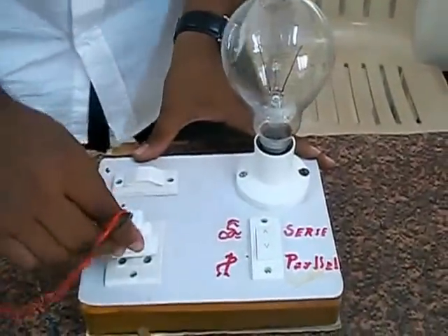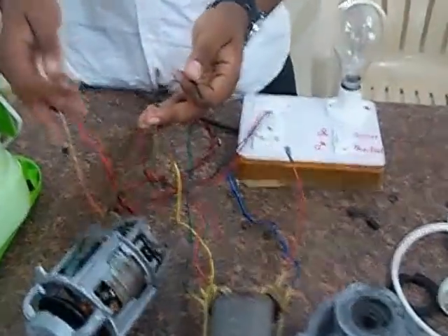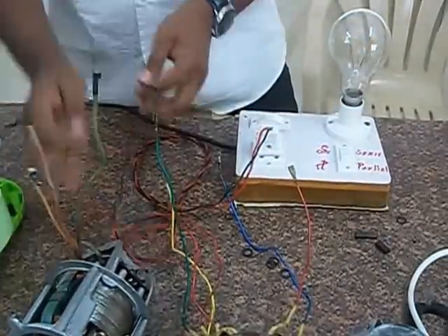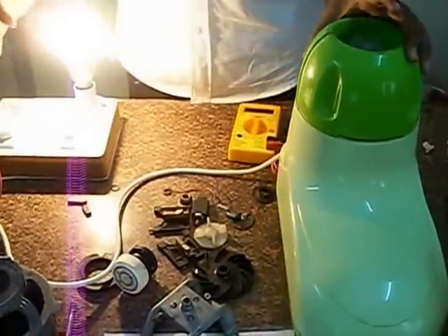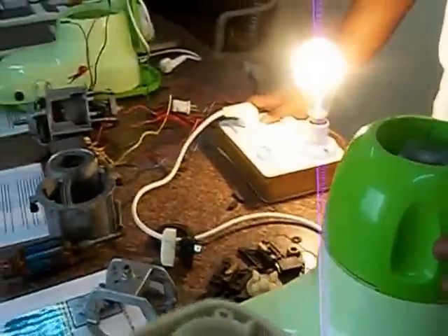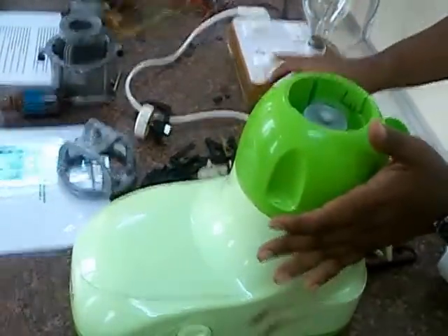With this series-parallel tester, you can check the winding. If the wires are short, it glows bright because there is a short circuit. This motor is a faulty one — the mixer winding is shorted. If the mixer is in perfectly working condition, the series-parallel tester will show a dim glow and the rotation is also slow, because the voltage and current are dropped in the series connection. When current is supplied directly to the mixer in parallel connection, the mixer gets full voltage, so the direct supply is given to the mixer.